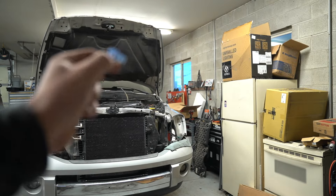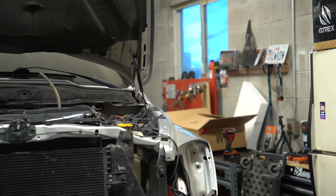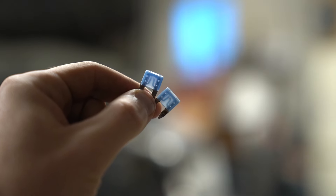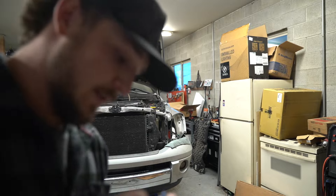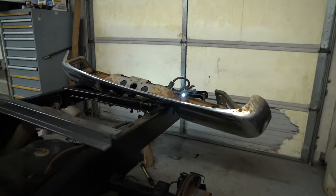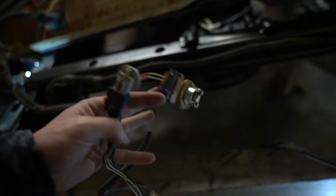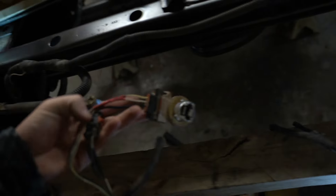I think we found the culprit — two broken tail light fuses: park light right and left. I'm going to get these replaced real quick and see if that fixes the problem. We do have lights back here — license plate lights are on. Testing with the test light, we're getting power here, so I'm putting the tail lights back in to test everything properly.